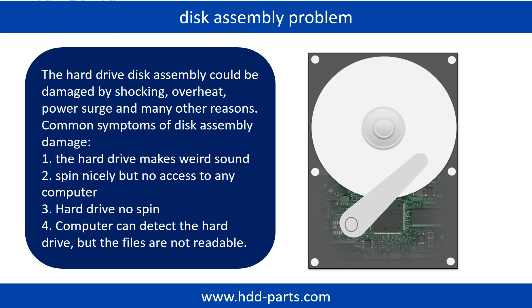If the storage is configured as mirrored hard drives, you can take the bad hard drive out, then put a same size or bigger size hard drive into the bay, and the storage will mirror the data to the new hard drive automatically. If this trick doesn't work, that means the two mirrored hard drives are both damaged, or the storage was configured as RAID 0, meaning the two hard drives are different.